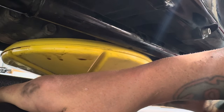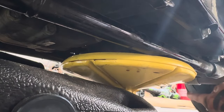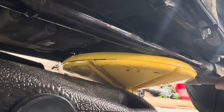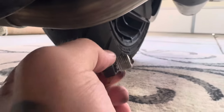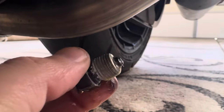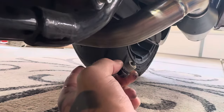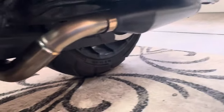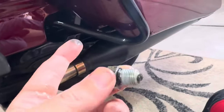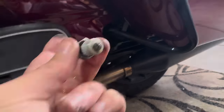Be quick with it so you don't make a huge mess. Once this pops loose — only a few little drops, not too shabby. We got our bolt out. If there's any stuff on the threading, take a wire brush to it, get that cleared up, and change the O-ring on that. O-rings are cheap — always change your O-rings. They're super cheap, there's no reason not to if you've already spent the hundred dollars on all your oils.